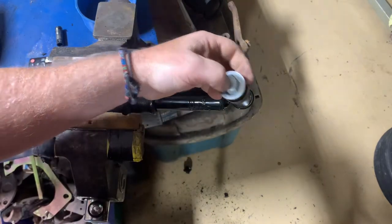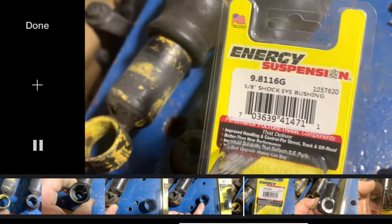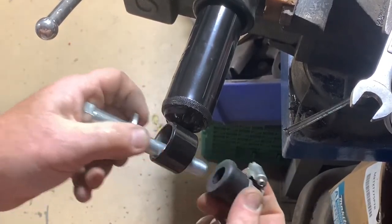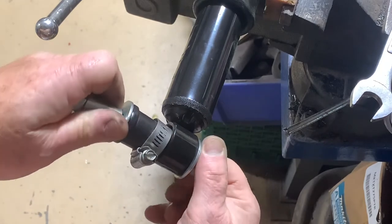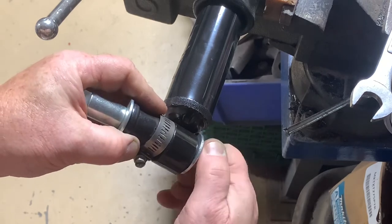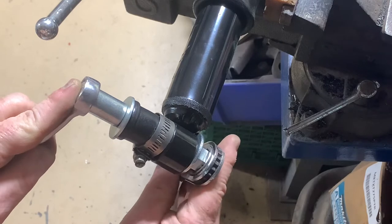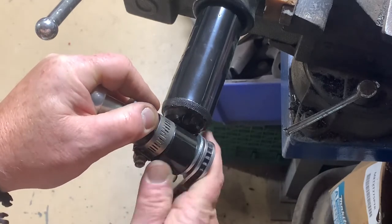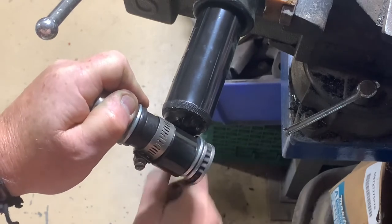I think I need to put a little bit of WD-40 or some type of oil product on there. Let me get this set up and put in here, and then we're going to turn this shock over and see if we can't get this to go in. I've made a spacer on the end of my bolt so that I'll have more room to tighten it up. These are Energy Suspension polyurethane bushings going in a Monroe gas shock, air shock.